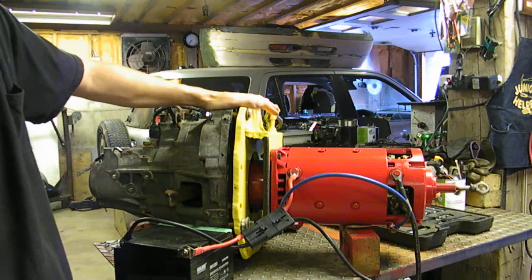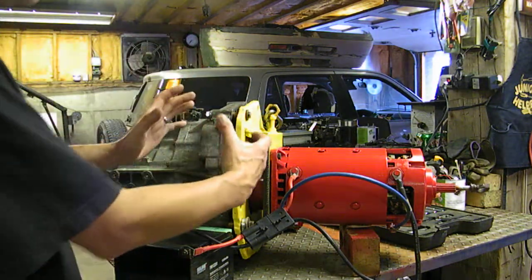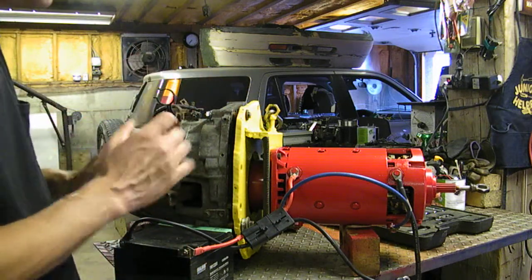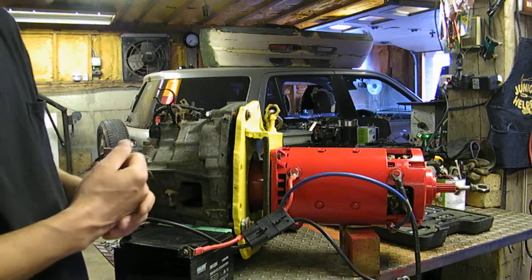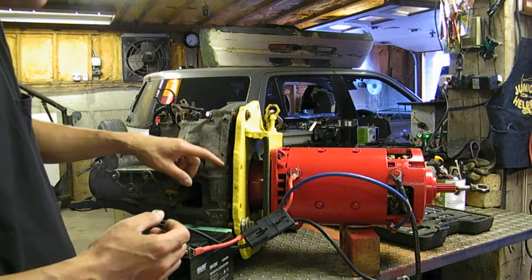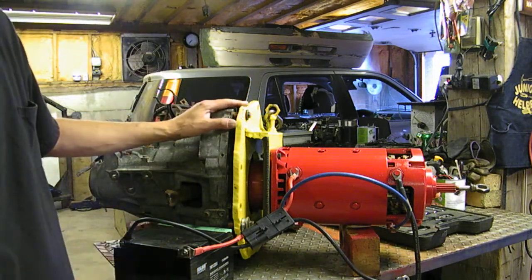So what I'm going to do is loosen off the three bolts I have on there, shift around the adapter plate and the transmission just a little bit, try and get rid of that small last little vibration. Then once I'm happy that everything's lined up perfectly, I'll put the rest of the bolts in with the spacers and get everything locked in and pinned nice and tight.